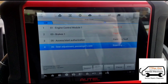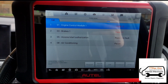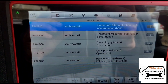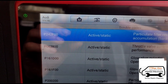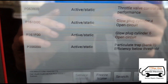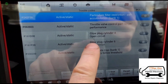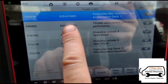We'll run a diagnostic scan - just come past the engine, pause that and check it. We have a particle filter fault for ash accumulation, and another one - particle filter below threshold. We also have a cause for this: glow plugs on cylinder four and six, and then the throttle body out of performance.